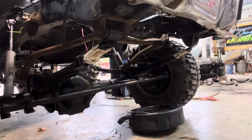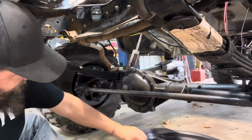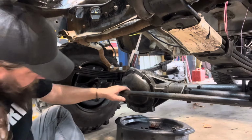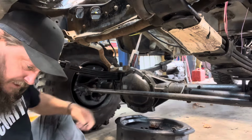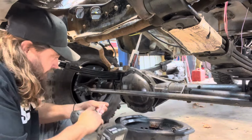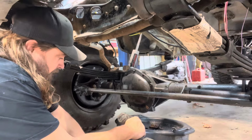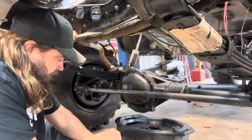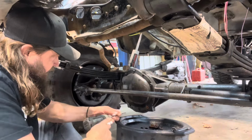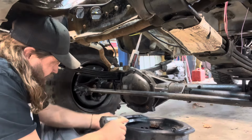It only takes a few minutes. So I'll set you right there. Let me grab a ratchet. Don't pull on the bumper because it's not bolted on. Basically what we have here is a 10-bolt Chevy. One of the most common axles ever made. Millions and millions of trucks had these. Parts are easy to get. They're easy to work on. Don't know what gears are in them. You hope for 410s. 410s are pretty good. 373s if you got some power and you're gonna stay 33.